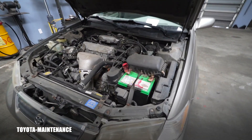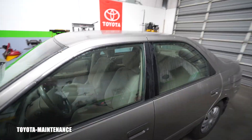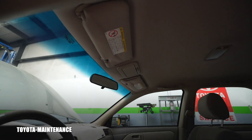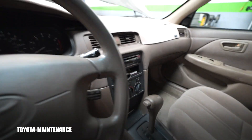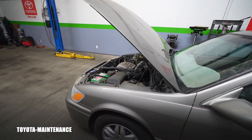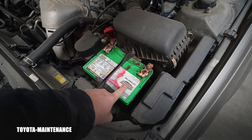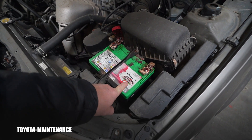For answering the dilemma of bad battery versus bad alternator — that will be the answer. But things are not always so simple. The battery could still be completely fine. The reason you couldn't start the vehicle in the morning might be because you left one of the lights on and drained it overnight. Or, for example, an incorrectly installed aftermarket radio drawing a small amount of current will completely drain even a perfectly fine battery within a couple of days. So we'll test the battery now.